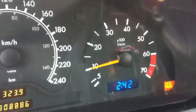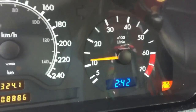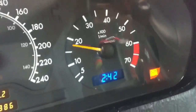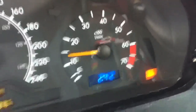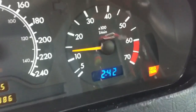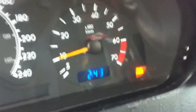Three or four minutes later and the car is really not liking me when I come to a stop — it's dying. I've remedied that by putting it in neutral just before I stop and coasting the last few feet, so there's no drag from the torque converter on the engine. I sit in neutral at the light and put it in gear when I need to go. That said, don't coast in neutral for any real distance — this is just a couple of feet and it's fine, but for regular driving it's not a good idea.